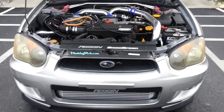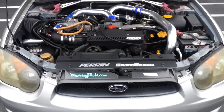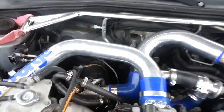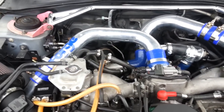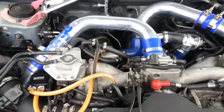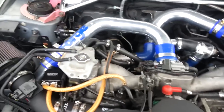But this isn't really about handling — it's about power. How does it do with turbo lag? A lot of people always ask about turbo lag being bad when you go front mount. The turbocharger on there is a VF39 running a front mount intercooler kit. I actually hit boost at the same RPM as I did with that big 4.5-inch core Turbo XS top mount — the timing hasn't changed. My air-fuel ratios are exactly the same, my ignition timing is exactly the same, and it does not knock.